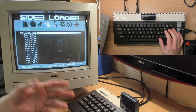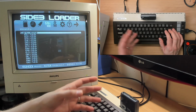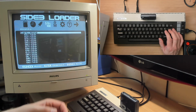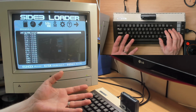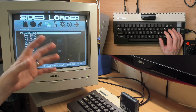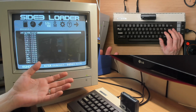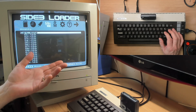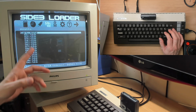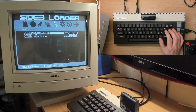RAM. So any disk image, any software on the disk image which messes around with the port B register, which controls the extended memory and the shadow RAM and the operating system ROM, often clobbers that completely and you lose your RAM-based operating system, so it's not great. But for the odd disk image, it does work perfectly well. You can actually boot DOS 2.5 using that method, and I think it'll even work with the RAM disk, so that's pretty good. So that's the mounts menu. So if we go along to the tools menu, there's just 3 little settings there currently.